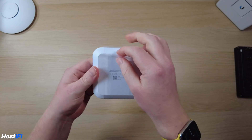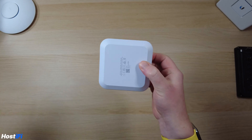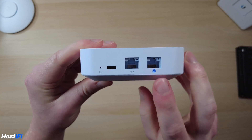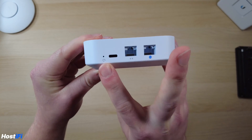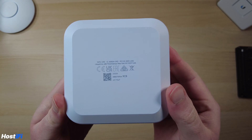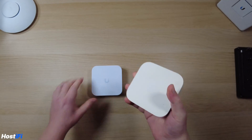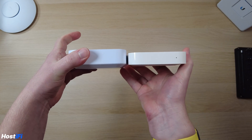Looking at the device, it's very similar to an Airport Express as a lot of people are saying — a very small rectangle device. Looking at the back, we've got two ethernet ports: the one on the right with the globe icon is the WAN port that connects to your internet connection, and then a LAN port, USB-C for power, and a reset button. All the ports are one gigabit — not 2.5 gig. There are no SFP ports. For comparison, I've got a very old Airport Express — Apple's own router from 2012.